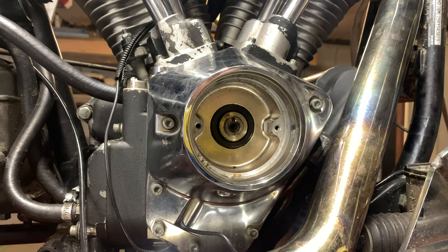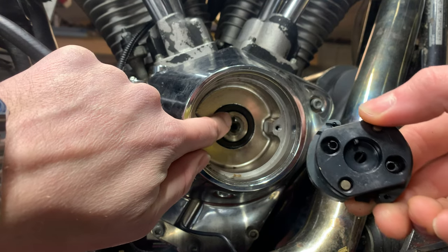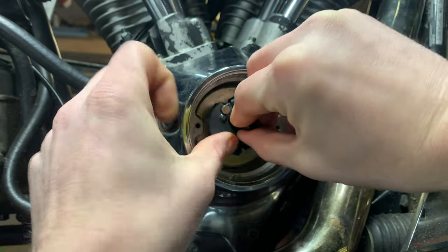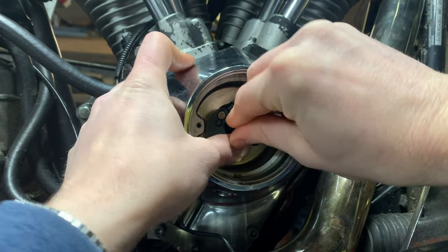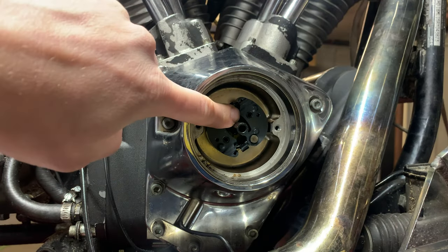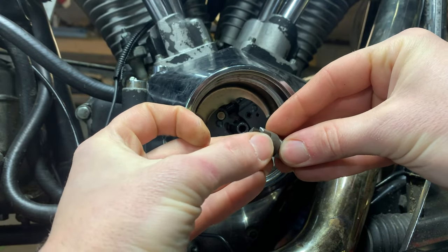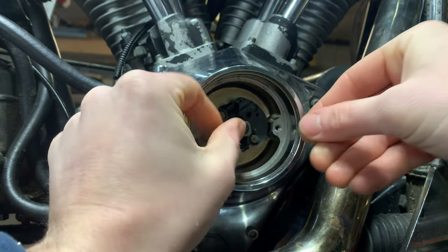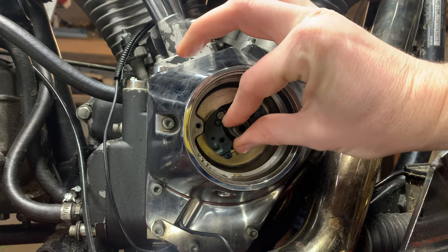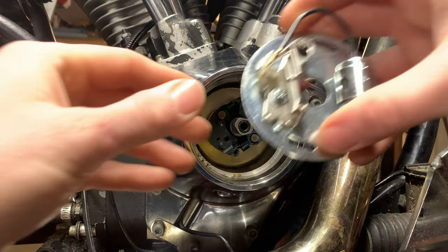We're back on the other side of the bike for the first portion of the install. That little cutout on the nose cone is what receives the pin from the mechanical advance. Loosely align them and pop it in — you'll feel it click into place. Now it's seated and the weights can move. When you put the cam lobe in, remember the flat cutout goes toward the pin. Slide it in, then check: pushing counterclockwise, the weights should open and close freely with no resistance — you should be able to move them with just the weight of your fingers.